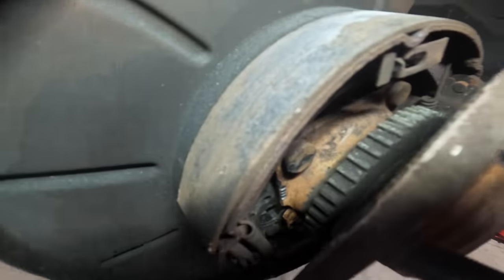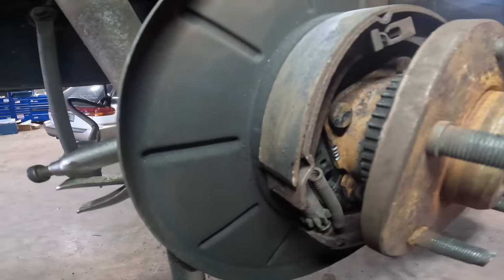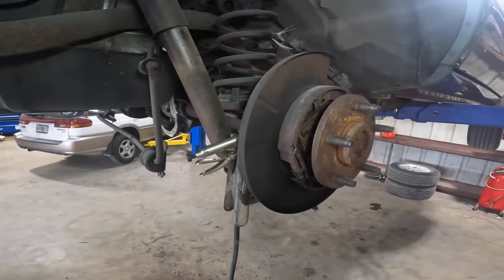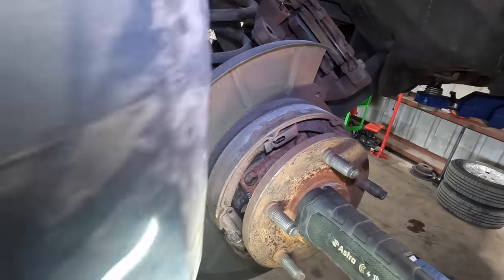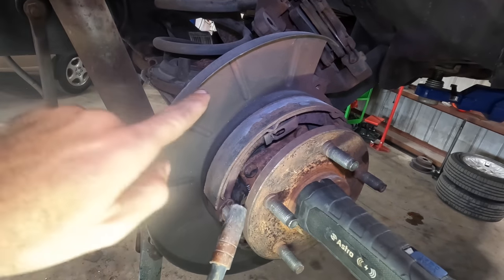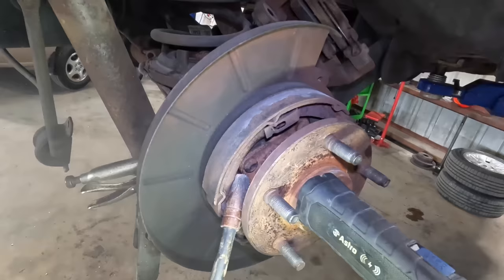Let's back up a little bit. I'm going to get in there with the welding tip and put a bead here, here, and one right there. That should allow me to get those bolts to come out and then we can get this axle shaft out of the tube. Welding mask coming on — now we're safe. What I don't want to do is weld the flange to the axle tube; I just want to weld the stud to the flange. Get in there, there we go.